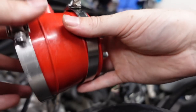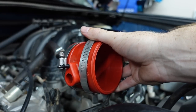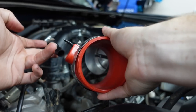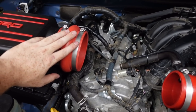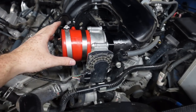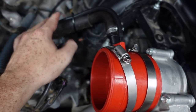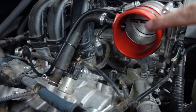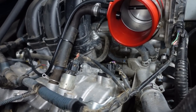Next, take this coupler — the smaller end goes onto the throttle body spacer. There's a larger hole and a male-to-male fitting they provide where the vacuum hose plugs into the top, and another hose with an adapter plugs in as well. We now have the grommets with a loose hose clamp ready to install, and I've attached and zip-tied the vacuum line. Getting this coupler on was a little difficult — just use a little dry lubricant or even spit and it'll go right on.